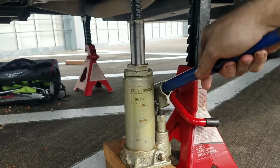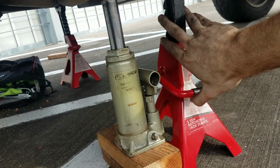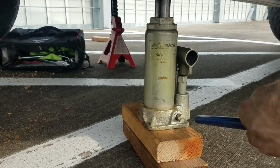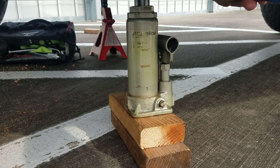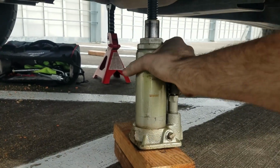Finally, once all 4 nuts are tightened back down, you can begin lowering the car. Ideally, the metal clunking when you go over bumps should be gone, and if not, you may have another loose suspension component. Another very common failure point on these cars that creates a similar noise is the lower control arm bushings.